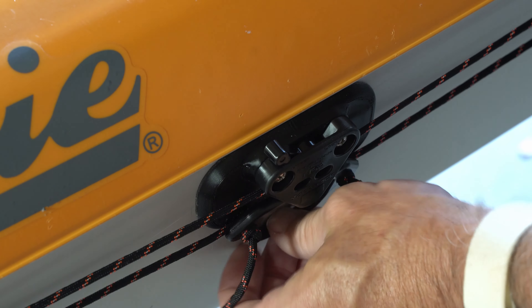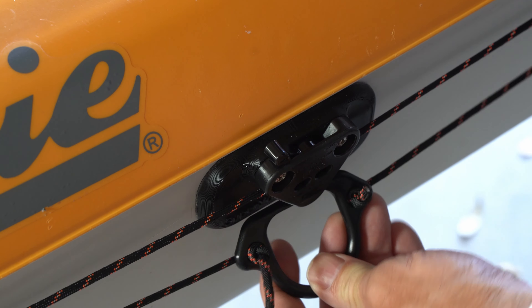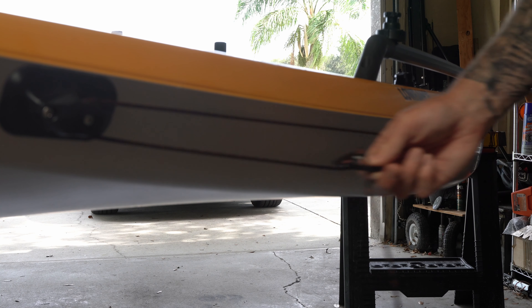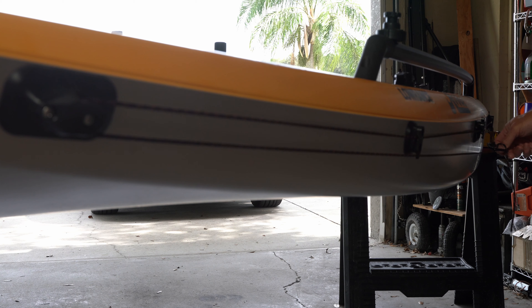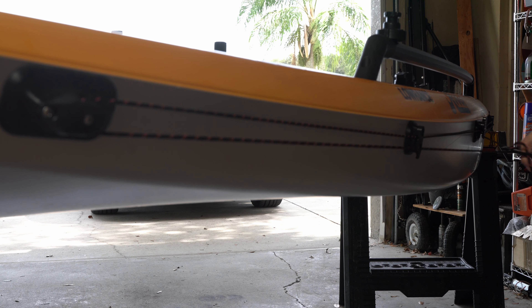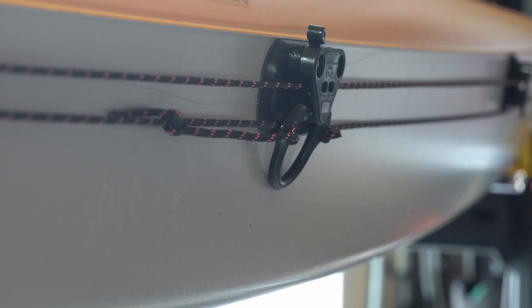This is how this whole assembly should look. You can see how in the trolley ring you can put it in and then push it down to lock it in place — all the way to the front, all the way to the rear. I can attach my anchor line or use my stakeout pole and point the boat in the direction that I need. Whereas before I was trying to use scupper holes, and even one time I ended up wanting to be anchored from the rear and I didn't have any anchor points, so I connected it to my crate, which didn't make me feel super comfortable. This is going to be much better because I can specifically put that anchor line or the stakeout where I want it. Anyway guys, thanks for watching — I'll catch you on the next one.